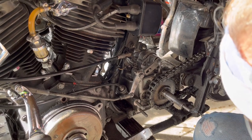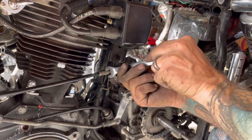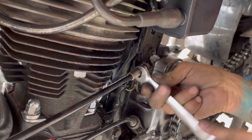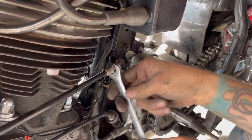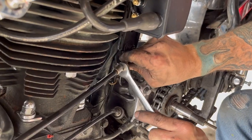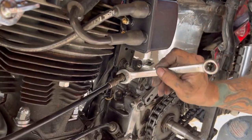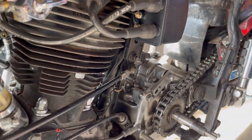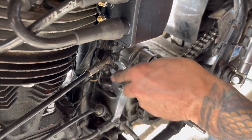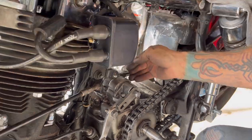My hope by doing that is that if I just take this right back to where it was, when I put it back together the clutch adjustment ought to be minimal. That's not to say it won't need adjusting because it does anytime you take it all the way down, but typically that'll get us in the ballpark. Then we'll lock that down with a 9/16 wrench. I'll grab the 9/16 instead of the 5/8 — just snugging it; I'm not going to mean-muscle it because I'll probably have to loosen and adjust it.